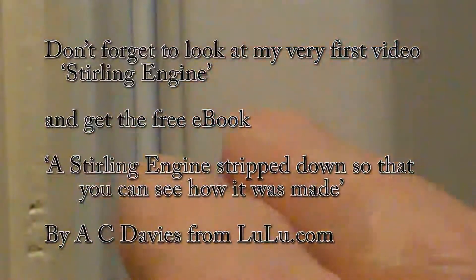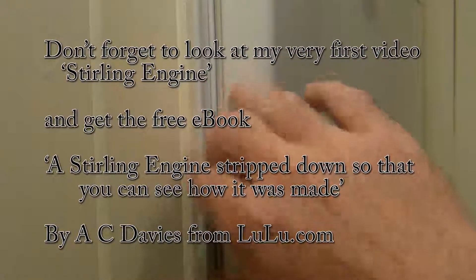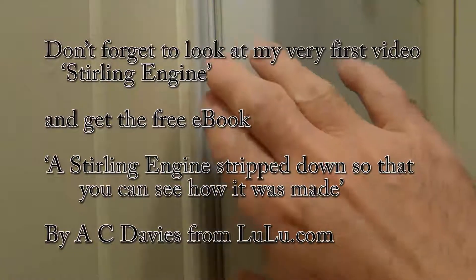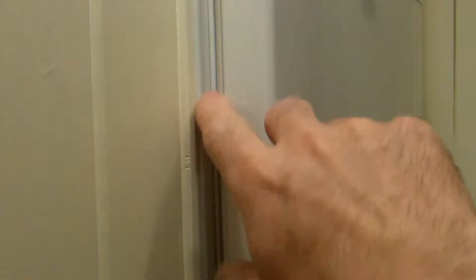Watch the seal when I close it — the door just carries on moving in, and that is the air contracting. Eventually when it all equalises and the air seeps through the tiny gaps it will come back out. When you close your freezer door and then want to open it immediately, you should notice it's harder to open the second time. If it isn't, it means you've got an air leak, and it's worth just checking the seals on your freezer.